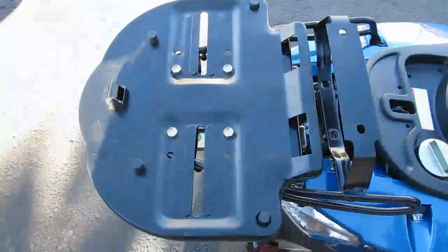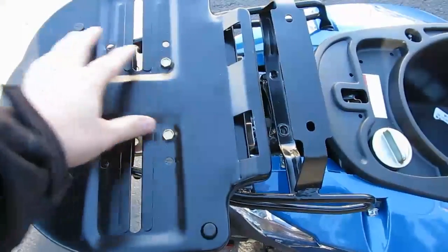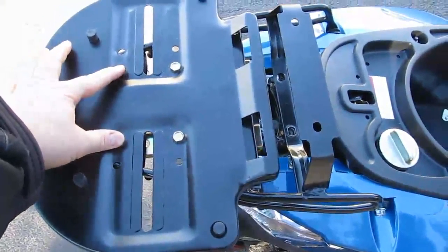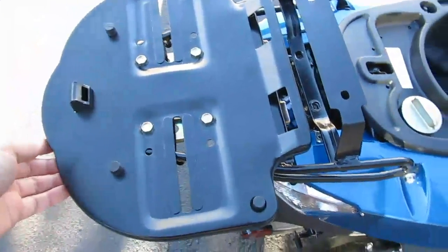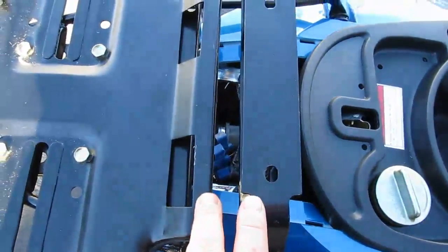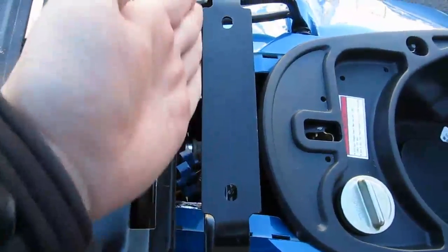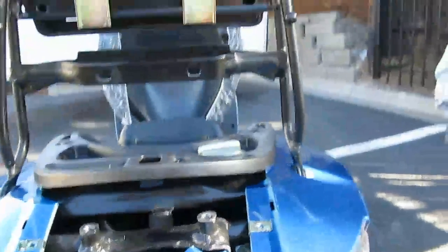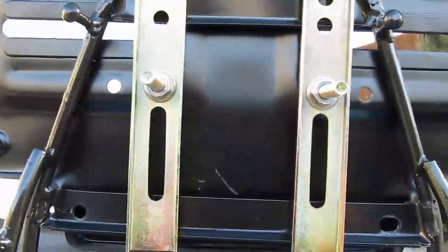I'd like to show you guys how the Bestem T-Box trunk attaches. You've got four bolts aiming downward. That holds the base plate in place, that holds it against the rack, and you can see you need to get a pretty precise spacing so that the trunk doesn't bump up against this top bracket. And here's what it looks like from the underside, so you can see the spacing.